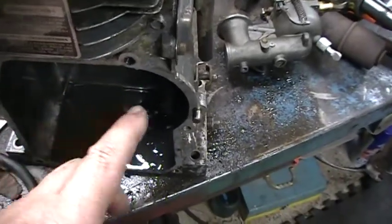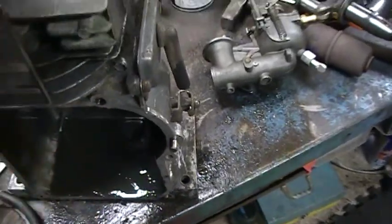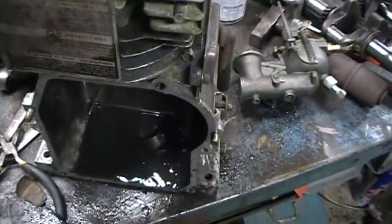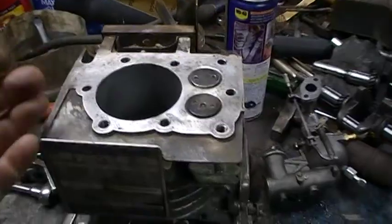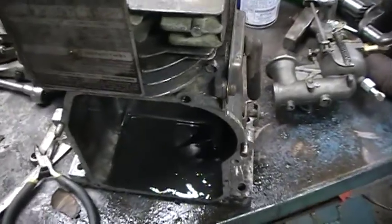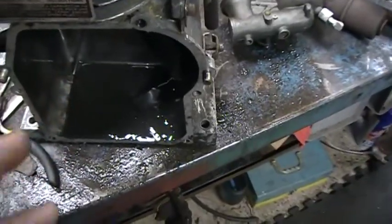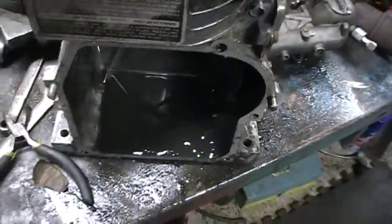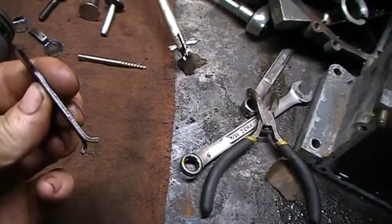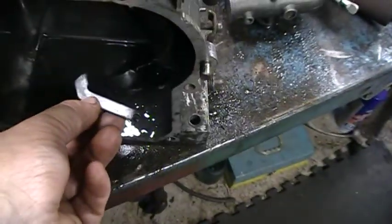Back up - when I bought this, it didn't have no oil in the motor. So I figured, well, it's got good compression, the valves are going up and down, it's got spark from the coil. So I put oil in it, see if I can get this thing fired up. I put oil in it and it started running, but it was making a bad rattling noise in the motor. So I started looking and the oil splasher that splashes your oil up into your motor was laying in the bottom of this motor.